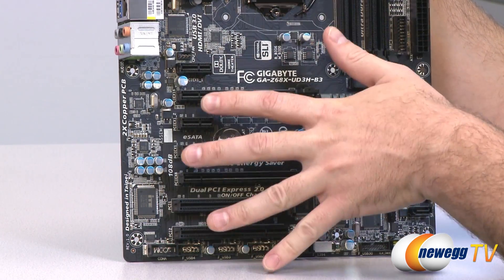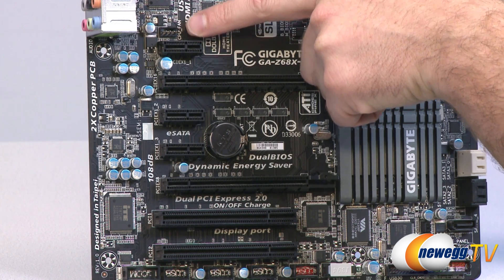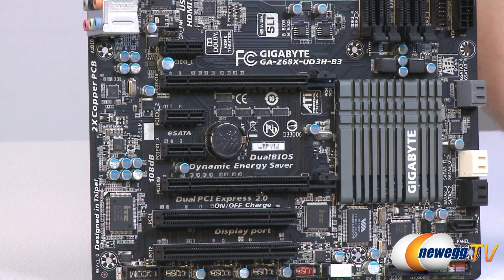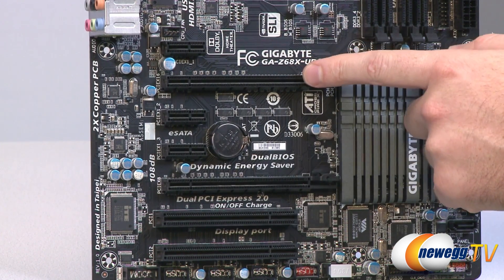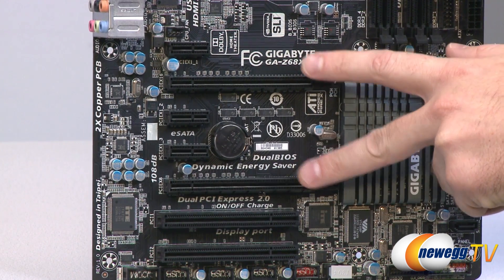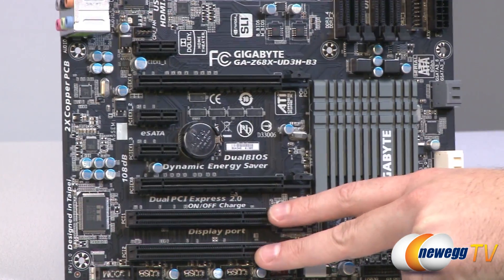Let's talk about the PCI area. While I'm in the area, here is your CPU fan header, which is right above the PCI slots on this particular motherboard — so bear that in mind. For PCI Express, we have three single-speed PCI Express slots. In between and below those, we have two full-length PCI Express slots: the top one is 16x where you want to plug your video card, and the bottom one is 8x. These are SLI or Crossfire capable; if you go with a Crossfire or SLI solution, both slots will default to 8x. Finally, at the bottom, you have two legacy PCI slots for your old-school PCI devices.